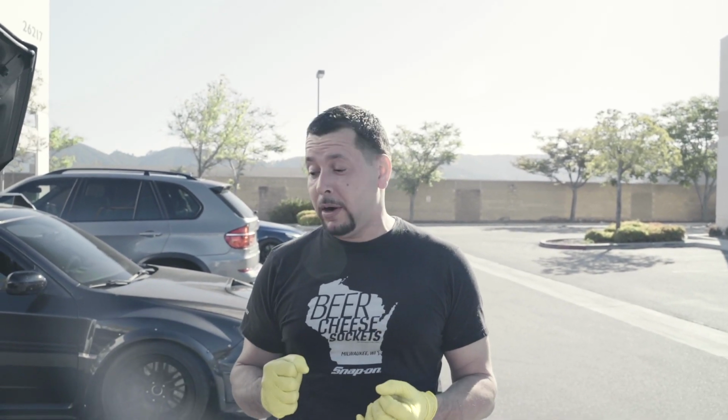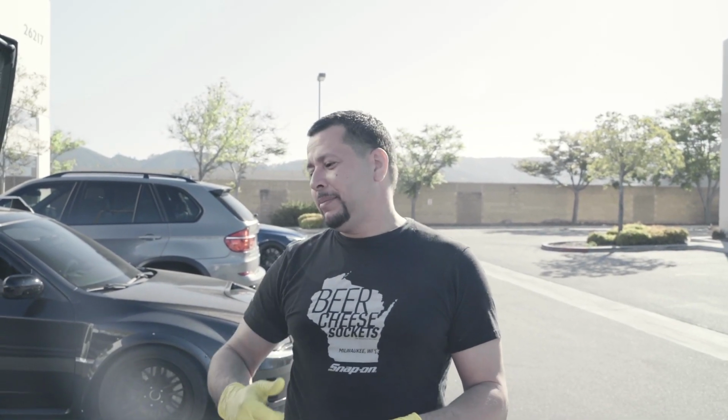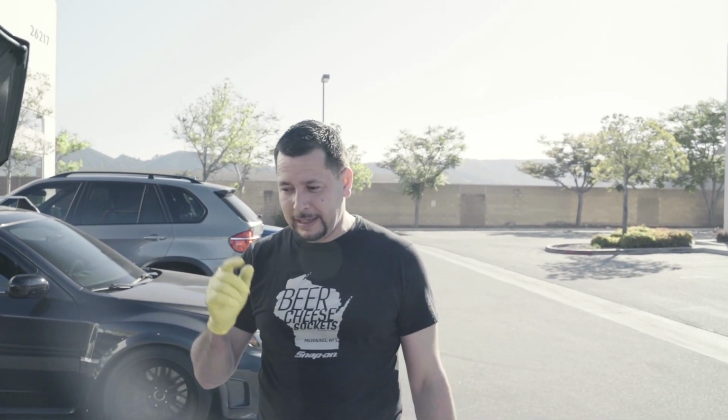We thought the clutch was slipping because it was pulling very hard, and as it pulls, it felt like it was slipping. Back at the shop, I remembered my neighbor Alex over at Sheepy Race had a similar issue with an Audi R8 on the dyno. It would reach about 6,500, 6,000, and the car would start sputtering. They also thought the clutches were slipping, but while tinkering and checking everything, he found that one of the injector pigtails was bad. They fixed the problem.